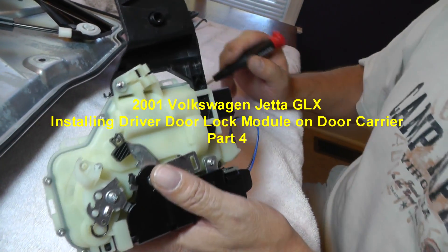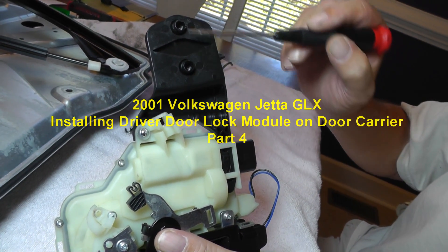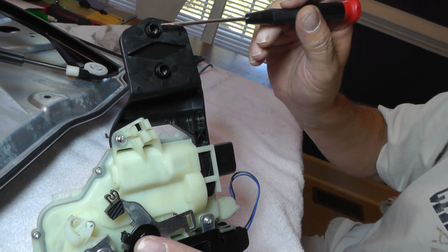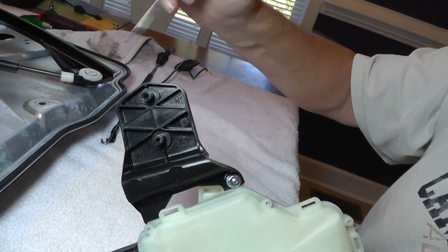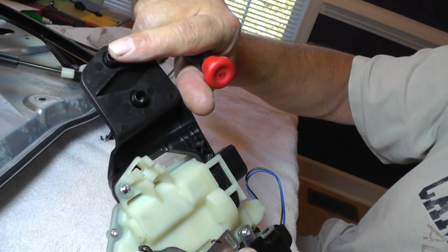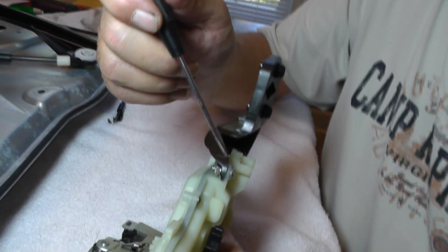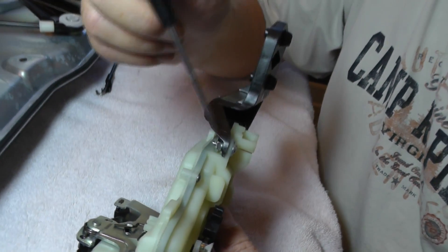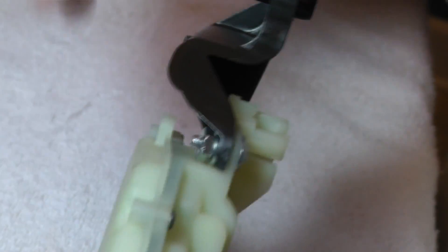Here is the driver door lock module. I went ahead and got this plastic bracket. These are the two pegs I mentioned in the first video when we tore this thing down — they're going to be protruding through those two holes. On the back side, there are two plugs that when you drive down with a hammer, they'll press into the inside, swell, and lock the bracket and door lock module to the carrier. When you tear yours down, you may find a rivet in there. What I decided to do was use a 6-32 by a half-inch long machine screw, two flat washers, one lock washer, and one nut.